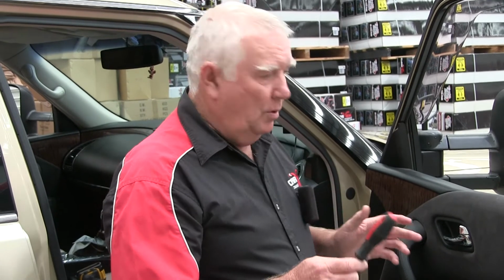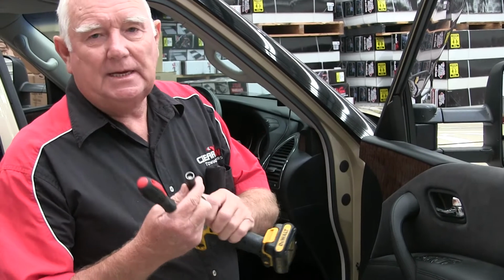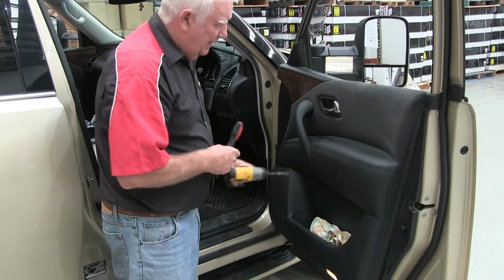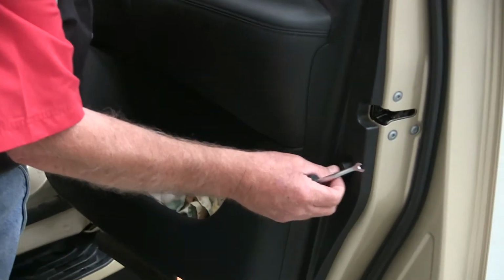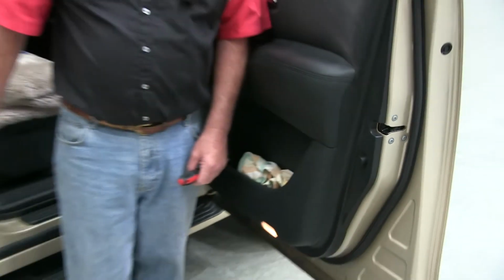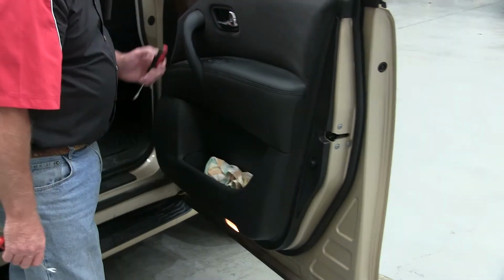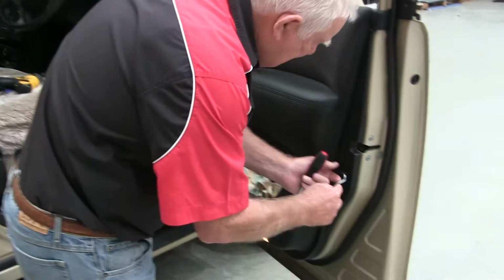Okay, the Y62 door trim is really quite easy. You've got 3 screws. You can either use a 10mm socket. I like these things because they just make the job quick and easy. Right, you've got one here, one under there, and another one down there. You've also got, over here, a bump stop that connects with your door light over here. That pushes your door light off. So that's got to come off, and 3 screws, and the door panel basically pops off. It's pretty simple. Right, just take this out.